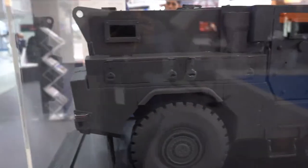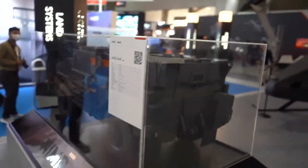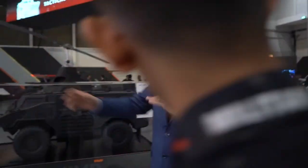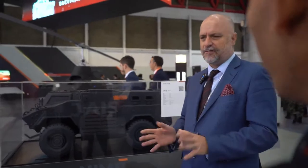One interesting thing about the Jace that makes it different from most standard MRAPs: the engine is side-mounted — it's not in the front. So you can give it the same level of protection all round without having extra weight in the front. This gives very good protection on the engine and the rest of the power pack. The engine is a Caterpillar, 450 horsepower, with a ZF gearbox — commercially available. The range is roughly 700–800 kilometers.